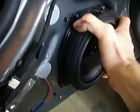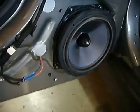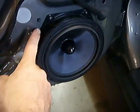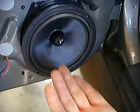As you can see, we've got ourselves a factory-looking install. It's solid, on there just like the factory. All the gaskets that the factory normally would have are on there. And deep inside that regulator area, she is right next to that track. One thing I like to do is put a piece of foam on the track or back of the speaker so it won't make a tapping noise, because at that close proximity the metal moves a little bit and can create noise.